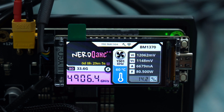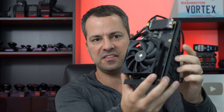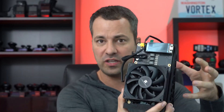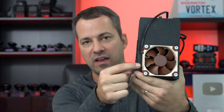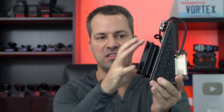Now with the default settings, you're going to be getting about 4.9 terahash, but I've been running mine overclocked with the stock cooling at 6.5 terahash and it's been handling it great. Part of the reason it's handling it is that the stock heat sink and fan are actually doing a really good job. Plus with the Revision 6, the voltage regulators are staying really cool stock without needing any additional heat sinks. You can also get it with an additional back fan on the rear side to cool the rear side of the A6 underneath the main heat sink.